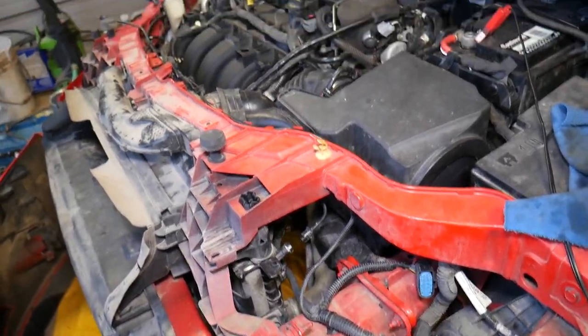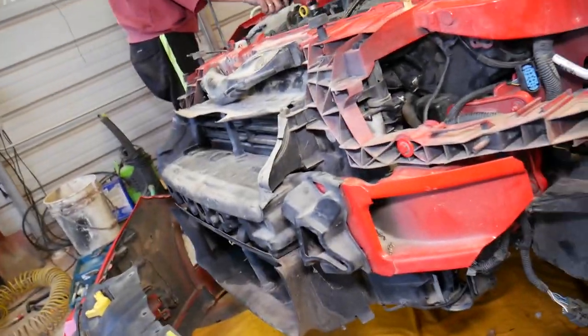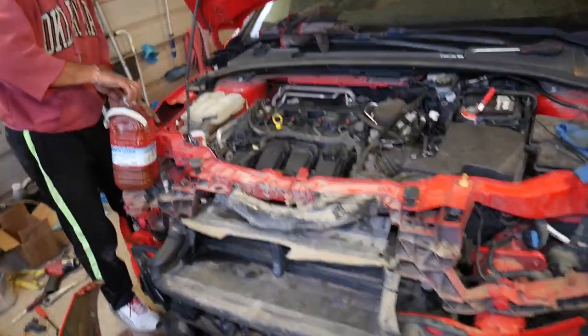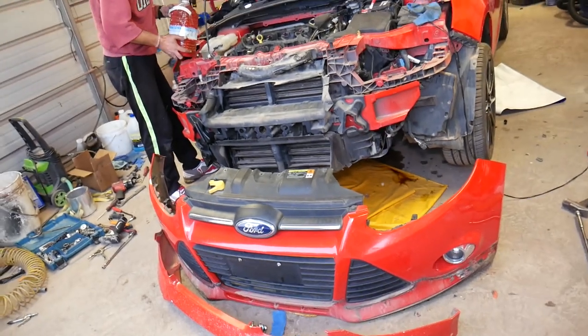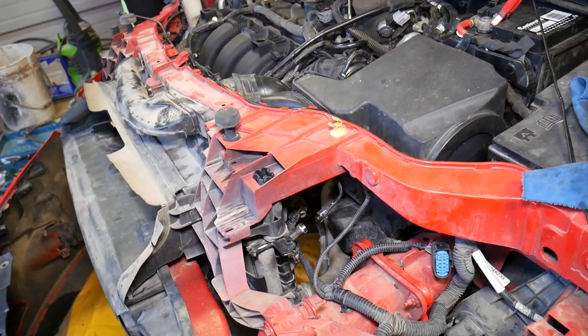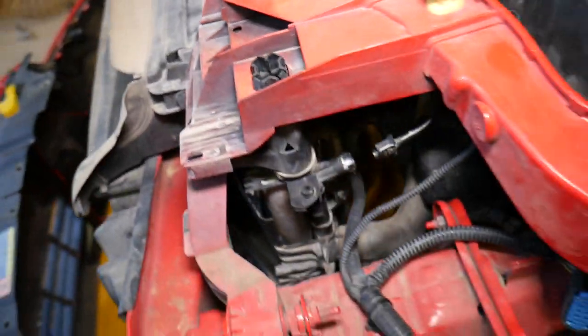That's not everything we need to do — make sure to stay to the end so you don't overheat your car. Next, we need some coolant. We have a pre-mixed coolant; if you want to buy Motorcraft coolant, we have the link in the description — you can get it for a great price. What we'll be doing next is keep adding coolant until we see coolant coming out of that open radiator port. Let's do that now. We start adding coolant and we're going to stop once we see coolant coming out.